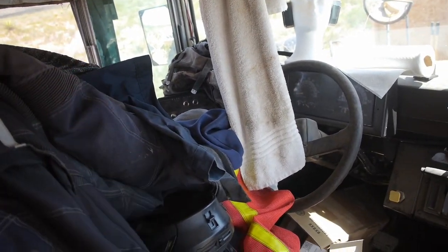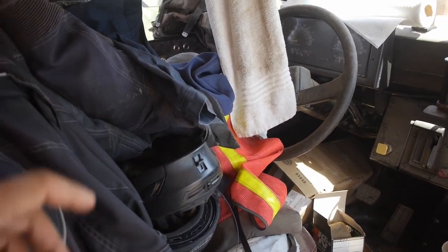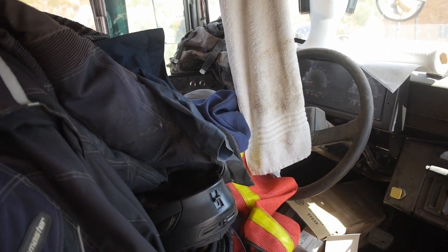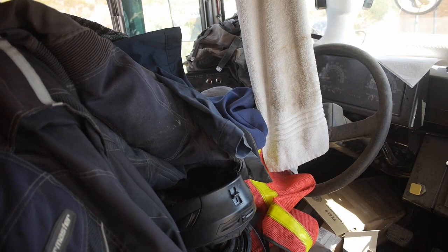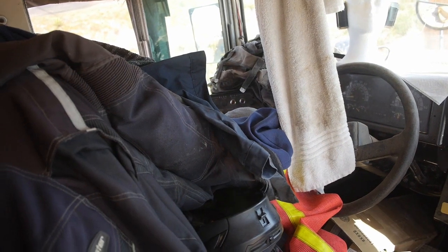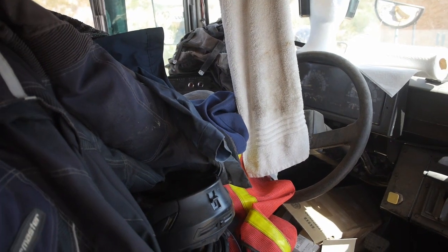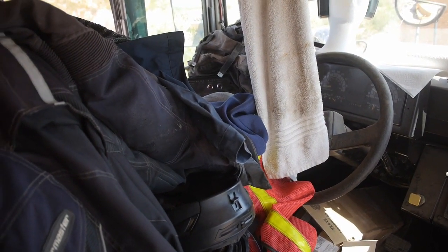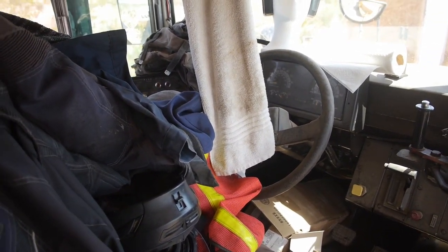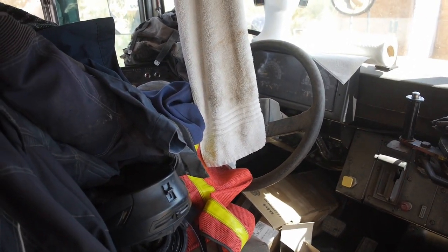So that's the direction I'm looking at — I have to get access to here first, start moving stuff and cleaning things up. Then I'll disconnect the battery and start pulling wire bundles apart. A couple rolls of electrical tape later, we'll have everything safely tied off. If I take wiring from the dome lights and rewire it to my switch panel, then the bus itself will be electrically inactive, basically. There's no reason for the bus electrics to be active at all — I'll just take the battery out and pull a few circuits over to my wiring, and go forward from there.